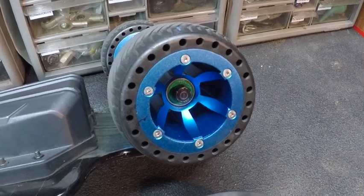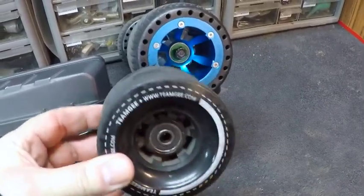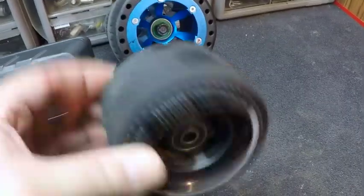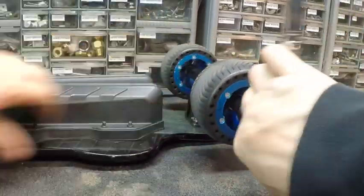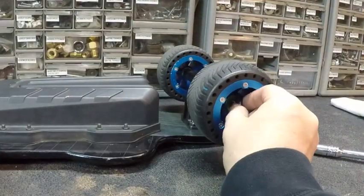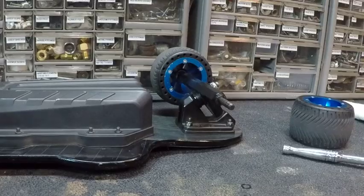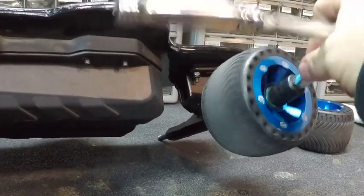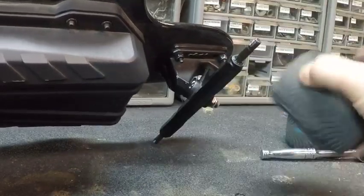It comes with two different sets of wheels — the big rubber ones and ones that are more like regular skate wheels, still a little oversized. They go over bumps great. The rubber ones pick up rocks a little bit more. With the larger rubber ones, because they're a larger diameter tire, you lose a little bit of torque and power — the edge of the wheel being farther from center means more torque working against you going uphill. Putting on the slightly smaller flat wheels makes the board feel like it has a little more power. The rubber ones are super cushy for cracks in the sidewalk and bumps on the path.